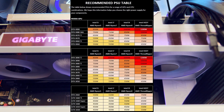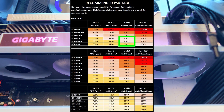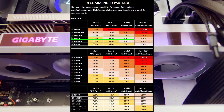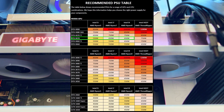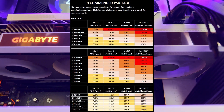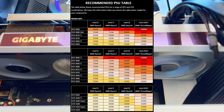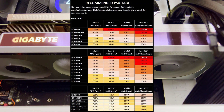Let's take the example of having an existing power supply unit with 650 watts. In that case you can upgrade your graphic card all the way from RTX 4060 or RTX 4060 Ti up to RTX 4070. You can also notice that the PSU recommendations for RTX 40 series are lower than for RTX 30 series — with 650W on RTX 30 series you would only be able to upgrade to an RTX 3060, which is still a good graphic card.